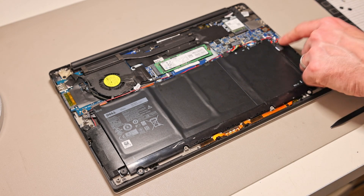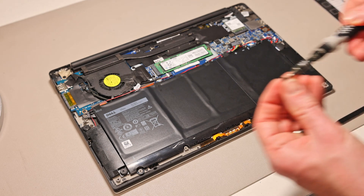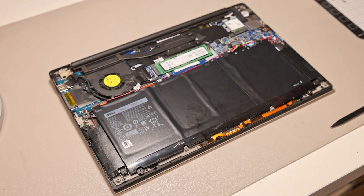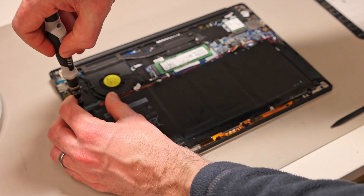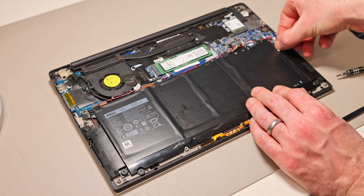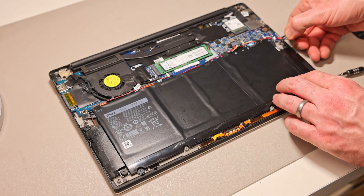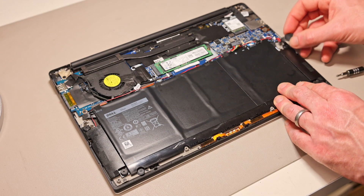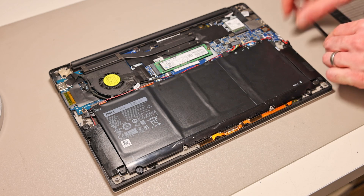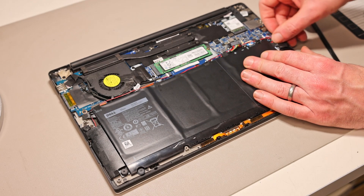In addition to the main battery, there is a small BIOS battery. You may want to go down to a Phillips PH00 size screwdriver bit for this, though PH0 does suffice. The BIOS battery is smaller than a CR2032 — it appears to be an ML1220 type with a connector on it. I'll put a link in the description. To remove it, take the lugs on the side, release, then plug back in and tuck into position.